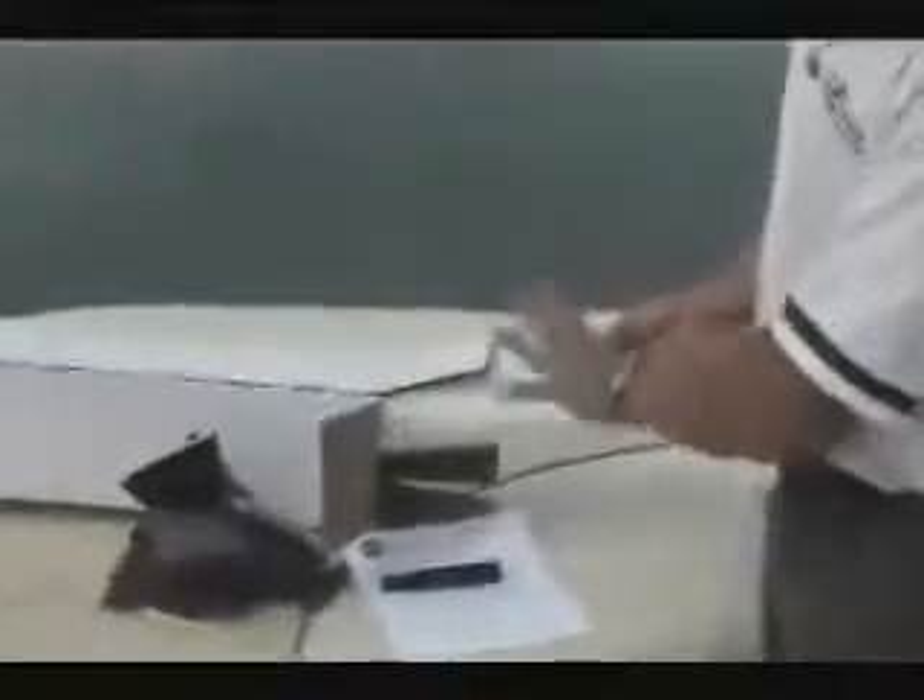The first step is going to be to remove your old carpeting. You've got to keep this because you're going to use this carpet to make templates for the carpet manufacturer to replace it for you. This whole process starts out with a template kit that you purchase separately. In that template kit comes 100 square feet of Mylar templating material that you're actually going to trace your old carpet pieces onto, along with pieces showing style and color options and a form you fill out with your specific information.